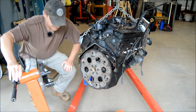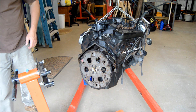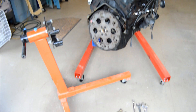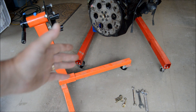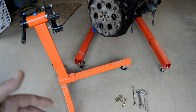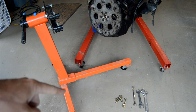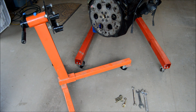So what you're going to need for this obviously is an engine hoist and an engine stand. I prefer the ones that have two legs out front. As you can see, this one only has one leg. The reason why is these things get a little tippier this way, so you need to be careful wheeling the thing around. If you hit a rock or a crack in the floor, they can be a little tippy. The ones that have two legs — so instead of the one in the center, it'll have two outboard, kind of like the cherry picker but they're straight out. I've got another one over there in my corner, but I'm currently using it for a short block.